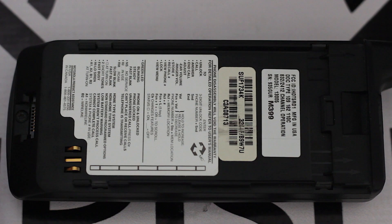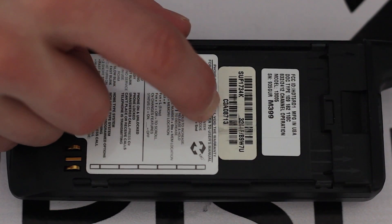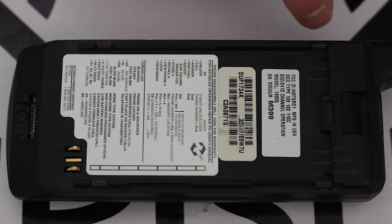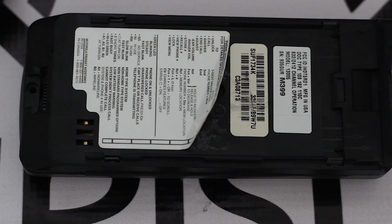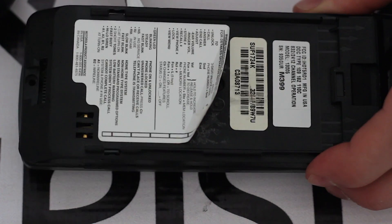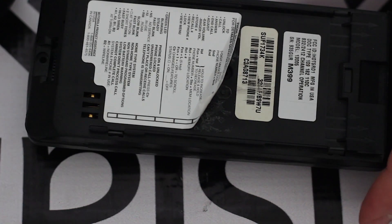How is this guy actually held together? It looks like there's at least one screw — this looks like a hex screw. I would venture a guess that there's something under these labels. I feel something right here that feels like it might be a screw. There are some push clips here that I'm going to investigate. It looks like I was right about these two screws, and then you just slide it out, squeeze to the side, pop the clips out, and boom!